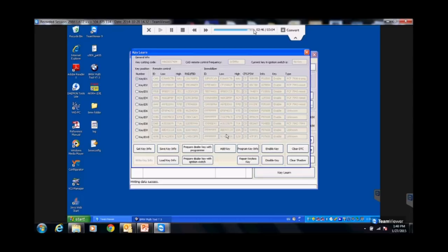Sorry, there's two ways that go on in the background, with two different tools. I don't use an AK90 here. But on an EWS system, you're reading the dump so you can access the information. It's got a table where all the keys are preset. It's got a hard code and there's a rolling code. If you pull up the screen where it's got the F's down the side, those are the rolling codes. The fixed code, the transponder code, is there. So your chip doesn't match that transponder code. You have to configure your transponder to match that code, or the other, harder way is you can read the ID number of the transponder and write it into that slot. EWS editor allows you to do that. That's to answer your question. I could write that key back into a different slot.